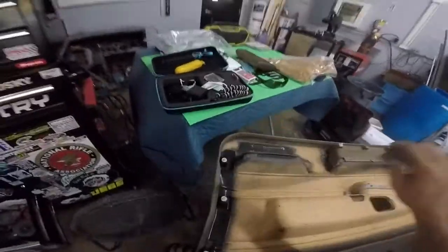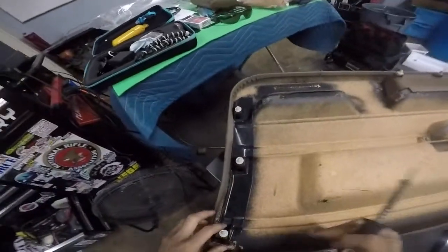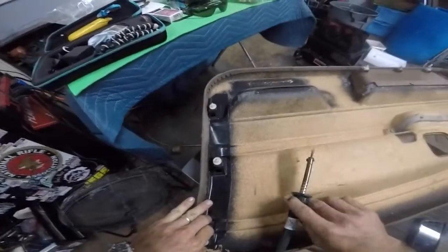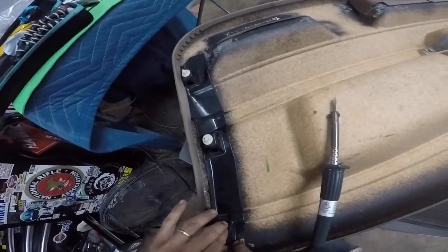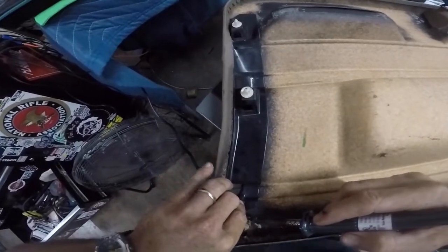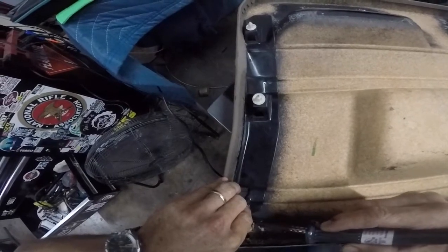My gun here should have been warmed up by now. So, all I'm going to do is one plastic welding. First of all, get a good solid tape to work on. I'm going to set everything to where it's designed to go, set it in there as best I can without it moving. I'm going to send a little tack weld into the corner so it will stop moving on me. You're basically just passing it over, fusing the two plastics together in a sweeping motion — kind of fill it in.